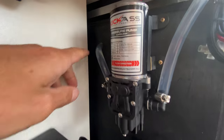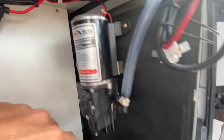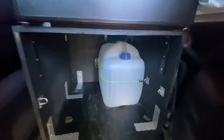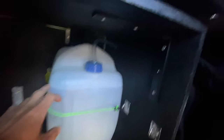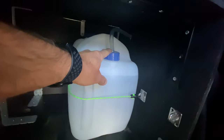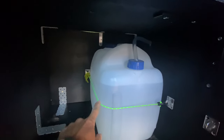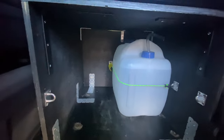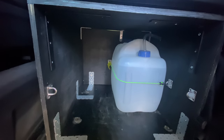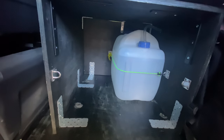Running the hoses for the water pump was very easy — I just drilled a hole straight through and the hose runs into our tank. This is our water pump down here, actually just underneath the fridge. It's a 23 litre tank and we can upgrade to a bigger tank since we've got the room. I drilled a hole to the side to bring our hose in, drilled a hole in the top of the tank, and put a couple of fixings in the corners with a bungee strap to hold it in place. The whole water pump install is probably around a hundred dollars — buying the pump, hoses, and tank. It's worked out really cheap and we're very happy with it.